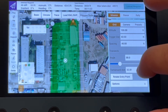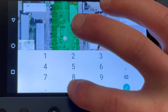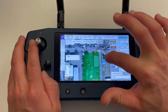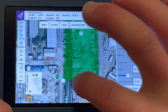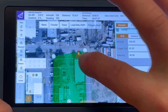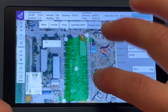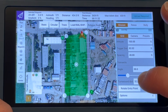Turnaround distance will adjust the overshoot distance the drone makes when turning at the end of each flight path, indicated by the white lines extruding from the green zone. You can now see how the drone will execute the flight path after takeoff, heading towards the start of the mission and then flying along the path indicated by the white lines and arrows. Once it hits the final waypoint, the drone will fly a straight path back to its launch point, indicated by the red line. You can adjust the entry point the drone starts the mission by using the rotate entry point button to cycle through the different options.